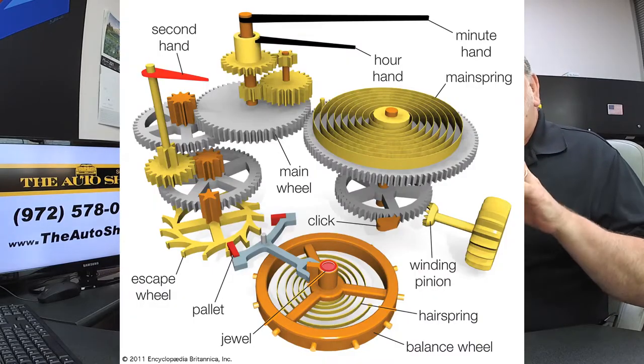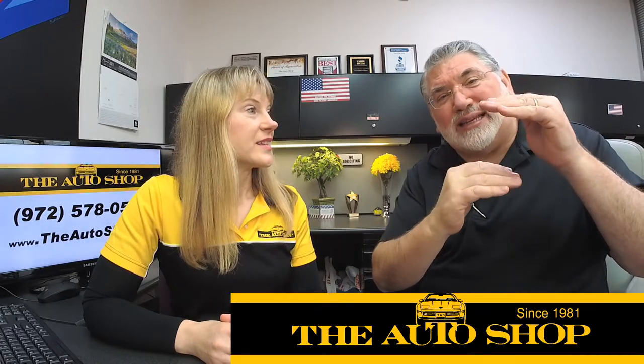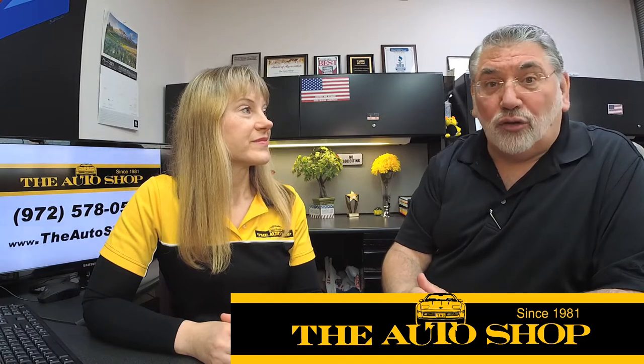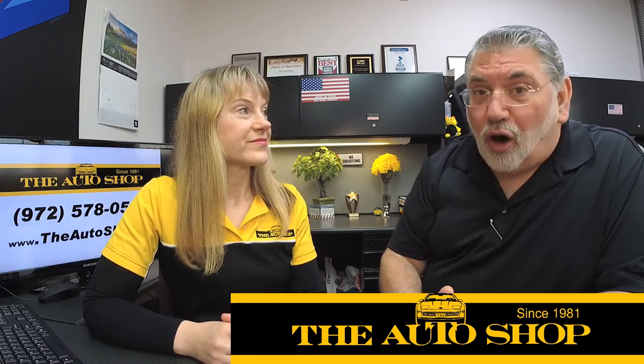I want to get into a little bit of how this works so you understand: the cylinder block and the cylinder head are two separate pieces. The combustion chamber of the vehicle is separated by a cylinder head gasket. Sometimes these two pieces are the same material, sometimes different — could be aluminum and cast iron, or aluminum and aluminum. When they start getting hot, it will blow the gasket from between them, and it can warp or crack either of those two major components, causing destruction of the engine.